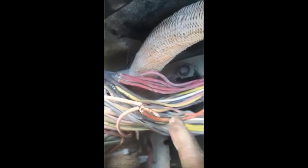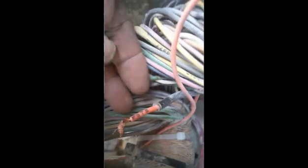On pin 44, the ECM gives 8 volts DC. These voltages go through this wire to the secondary brake sensor, the torque converter temperature sensor, and also the brake oil temperature sensor. This wire had a short inside the harness. Therefore when I remove this wire — I show you this wire I have removed — it was shorted in the harness.